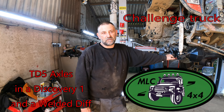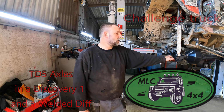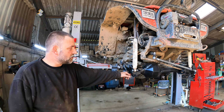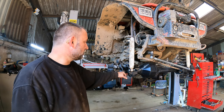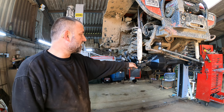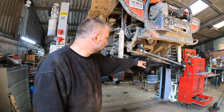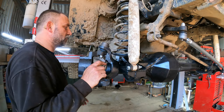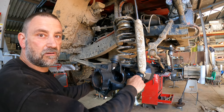We've got two three-day events coming up, so what we've decided to do is change the axles on the challenge truck. Originally it had Discovery 1 axles, but now we've gone over to Discovery 2 axles. We've replaced all the Discovery 2 bracketry with Discovery 1, put a 6mm diff guard on it, and relocated all the shocks into a slightly better location than they were on the original.